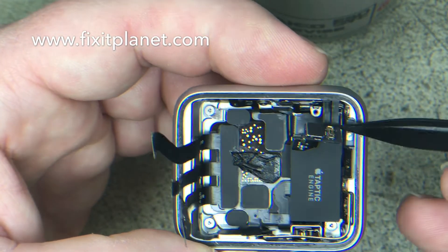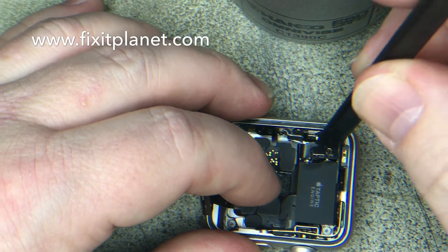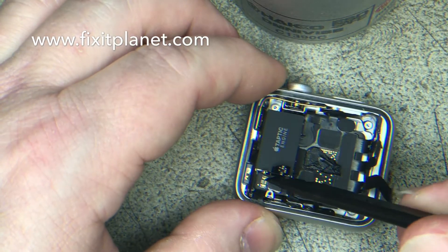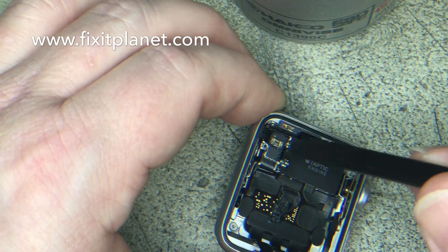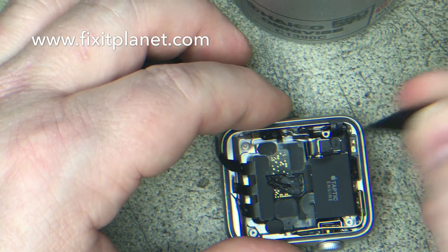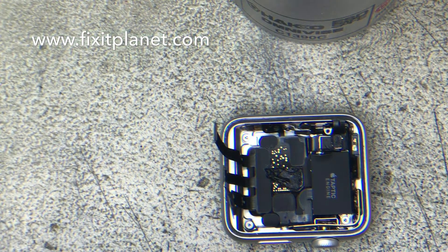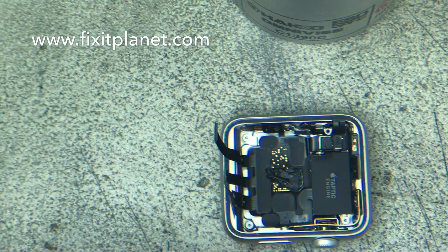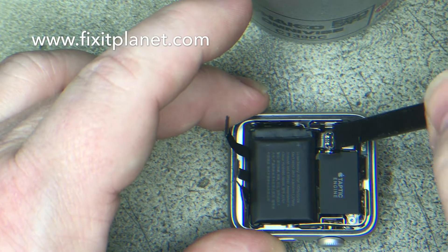You can then remove the gasket — everything can be taken out if you need to replace that force touch sensor gasket. If you damage these cables, be sure to clean the edges up really well. Then you can put the new one back in, reseat your pop connector, and clamp it down. We have kitty narration in the background — and now chihuahua narration. I must be at a zoo! So we just put the battery back in.